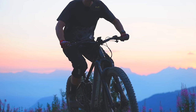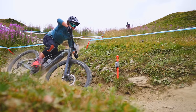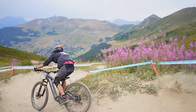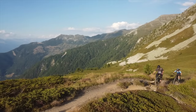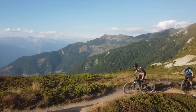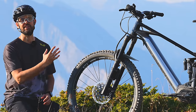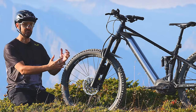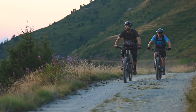If you're locking up the front wheel, that usually means danger and you're going to slide and probably crash. Locking up the rear wheel is actually something we do on a lot of bike rides — skidding, locking it up to swing into a corner, or getting that back wheel loose. The speed sensors exist on both wheels so the system knows if there's a variation in speed. If the front wheel is traveling slower than the rear, the system knows it's about to lock up and applies ABS to the front. The rear wheel remains just as we know and love — no ABS there.